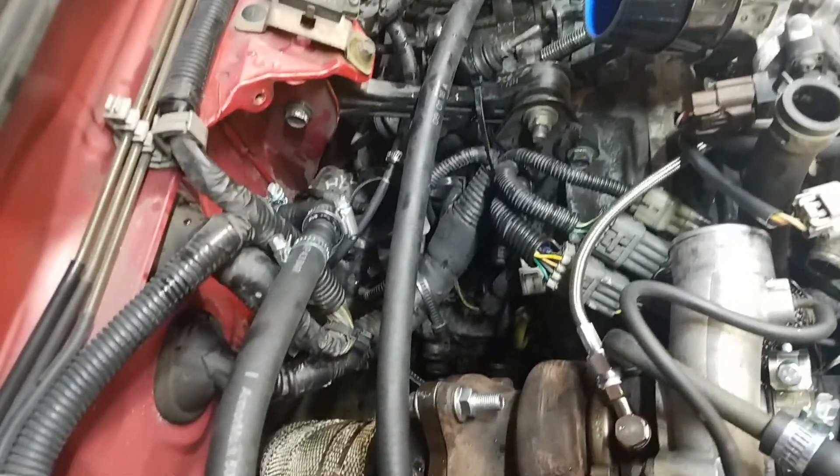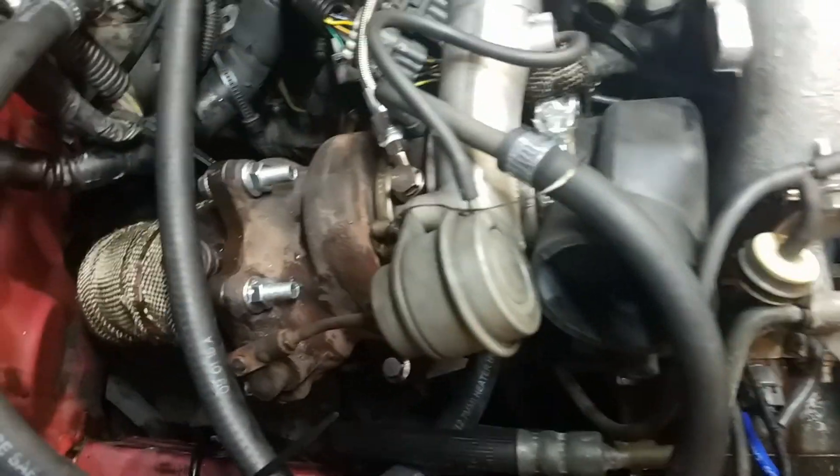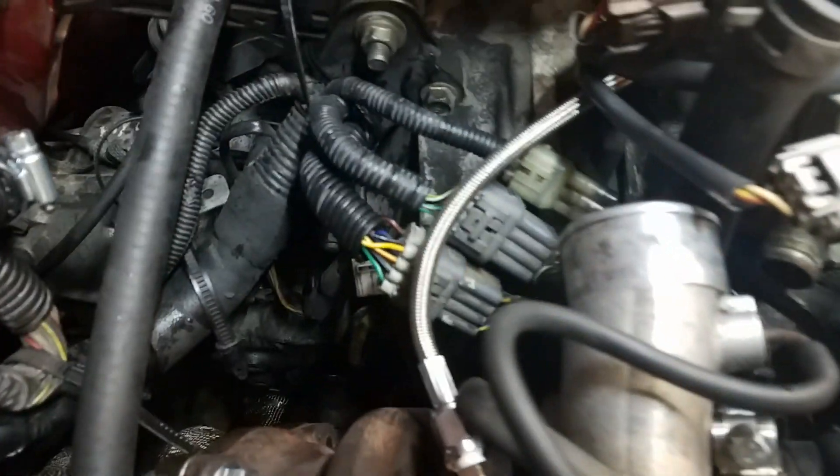So update — it's about 10:30 at night. I got a lot done today. Total time since I got the uppipe and started the install has been about four and a half hours. I've got the turbo in. It leaked a little bit of coolant — I had to cut the stock heater hose a little more than I would have liked — but the coolant line is all up, oil is all up, electrical is out of the way. I used a zip tie and some exhaust wrap to hold the wiring to a hose and a metal pipe.